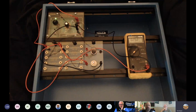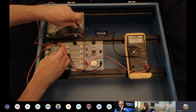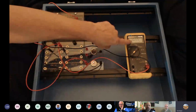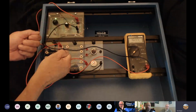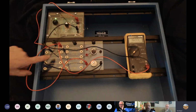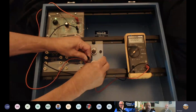This is where I would tell my students, I like you to come up with having checked something 3 or 4 different ways, so I want you to do a different kind of a voltage drop. I want you to pick up the ground, and I want you to come over here and actually go across that resistor and get that math. Let the meter do the math this time. So now I've verified it both by ground reference, and then I've come up, picked the meter up, and done both leads on different sections of the circuit, and found 10 volts drop right over there. I can do the same thing by coming back over here and picking it up, the last 2 off of the bulb.